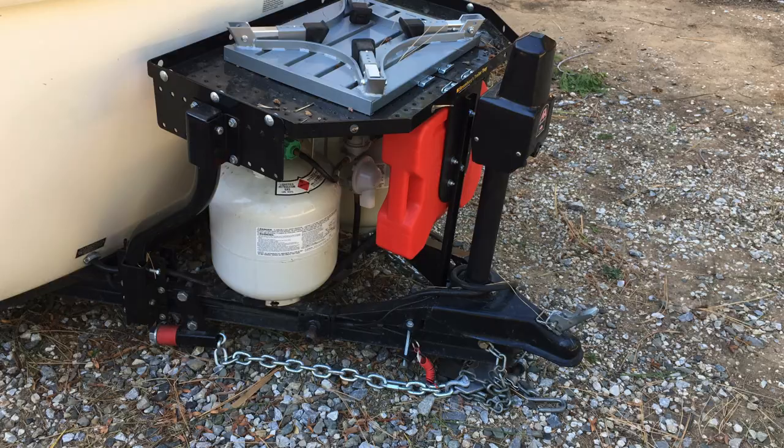And also when I put on the shock bracket that goes on the axle, I only took out one axle bolt at a time. So there was always one in place, so there's no way the axle could shift. Also, I did lower the tongue jack as low as it would go after I disconnected it from the car. That way it lifted the back of the trailer up as high as possible to give more clearance to work under there.